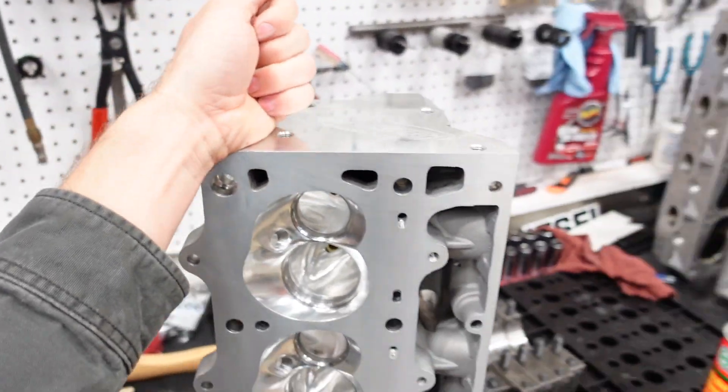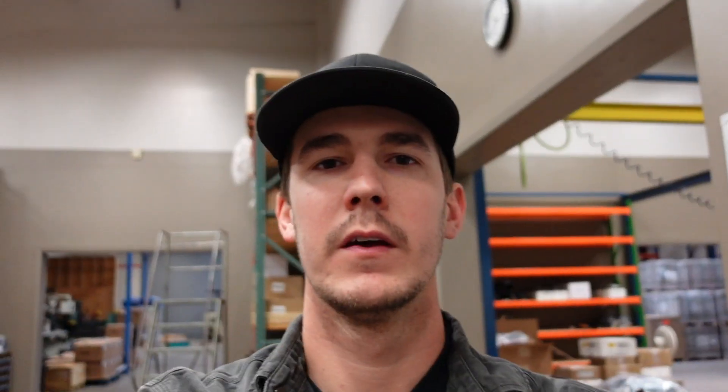So we're going to do a first test with the 11-degree head versus the 15-degree cylinder head. Second test is going to be high-ram intake versus the performance carbon big high-ram replica style intake manifold. Then we're going to do 93 octane versus E85 on an 11.25-to-one compression engine. Obviously a high-compression 13, 13.5-to-one engine is going to pick up a bunch on E85, but for the guys running lower 10.5-to-11.5-to-one, what actual differences are there? Because at that compression you could still run full timing with 93 octane, so you're not going to gain horsepower by adding more timing. It'll be a better test to represent the added oxygen content in the fuel and what that equates to in horsepower.